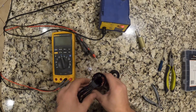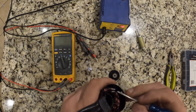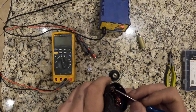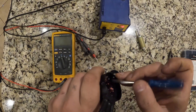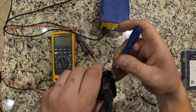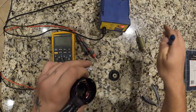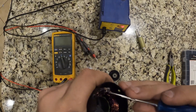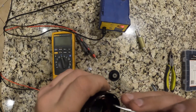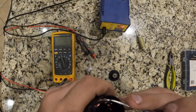I'm going to go ahead and solder that back together. There's a little ball of solder in there. Everything else looks good inside and the windings themselves don't really look overheated, so I think once we fix this it should be good to go.